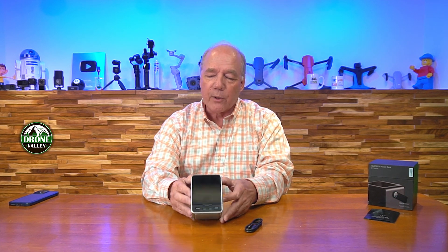The battery chemistry is incredibly smart in this unit. On the front you'll find four USB ports: two full-sized USB-As and two USB-Cs. Those can be used to charge external devices, and the USB-C also charges the unit — just plug a high-power wall charger into the USB-C port on the front. It charges incredibly quickly because it supports both PD and QC. The two USB-A ports are QC ports — intelligent ports that interrogate whatever you plug in, figure out the required voltage and current, and adjust accordingly to charge it quickly and safely.